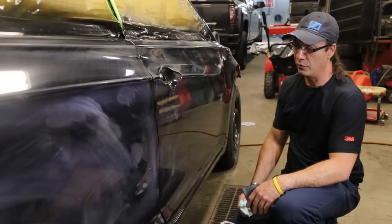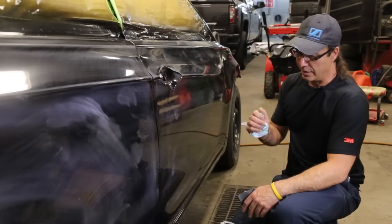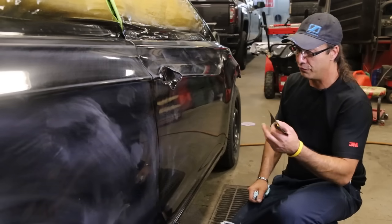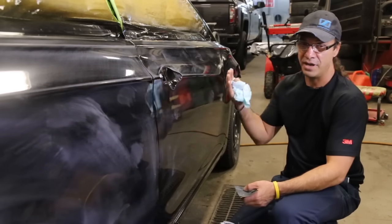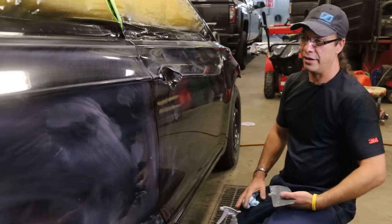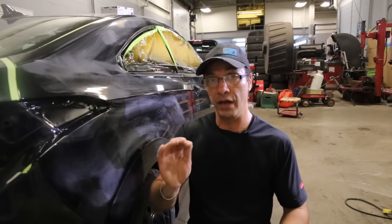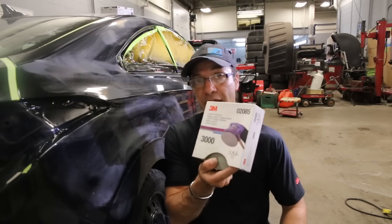I've left the orange peel, which leaves that factory finish. I just de-nibbed again. If you have a piece of dirt that's a pretty decent size and you can feel it, you should really do it with wet sandpaper because the 1500 on the DA just isn't enough to cut it. So now we're going to go to the 3000 wet. We've gone from 1500 dry, to 1500 wet by hand for the dirt nibs, and now we're going to go to the Trizac 3000.